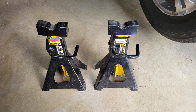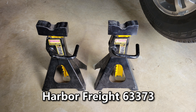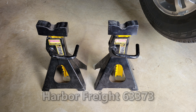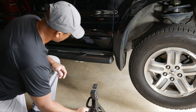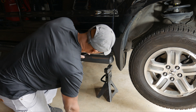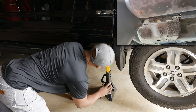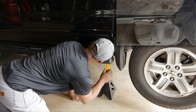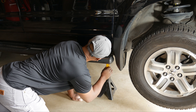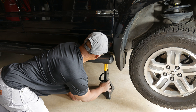The jack stands I'm using are 3.5-ton Craftsman Professional, and I've added some jack stand pads I bought at Harbor Freight to not mar the pinch welds any further. Once the car is jacked up to the desired height — maybe a couple inches beyond the ultimate height when the car is later set on the stands — I'll set the jack stands in place under the pinch welds on the driver side and passenger side. To keep the wheels off the ground, 17 inches seemed like a good height for the Pilot, which is 6 clicks on these Craftsman jack stands.